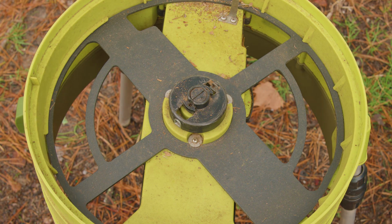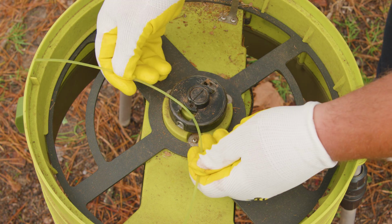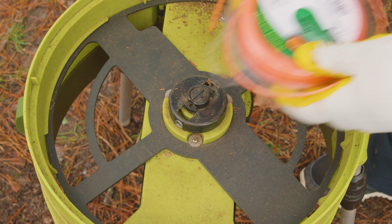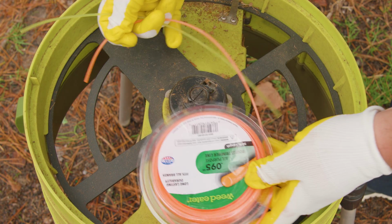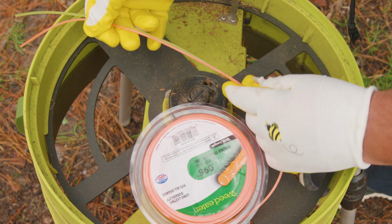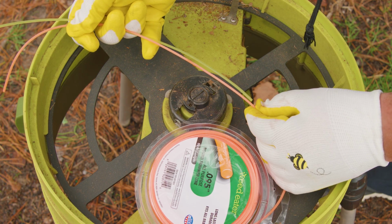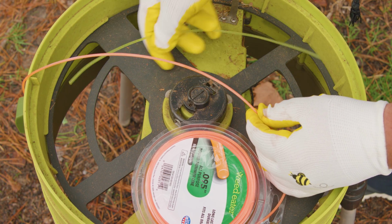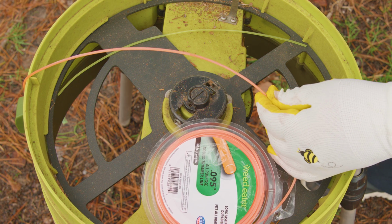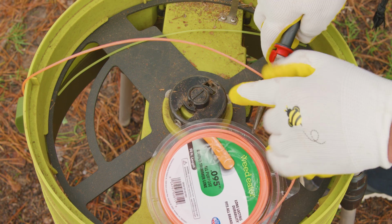Now that we have a clean slate to work with, we're ready to install the new line. You can either use the pre-cut line that comes with the machine, or that you can order, links in the description, or you can make your own line. At the end of the day, it is just thin weed eater line that you can get at your local hardware store or online. A pro tip, what we like to do is save one of the pre-cut lines or either the measurement of it, so that we know how long we need our new DIY line.